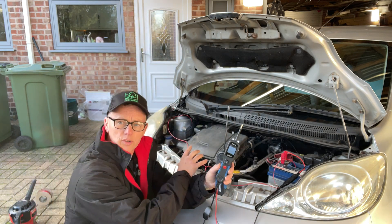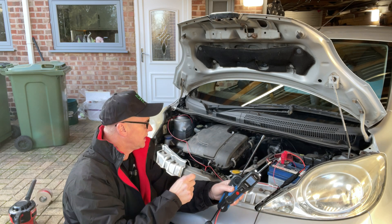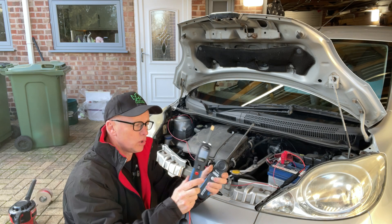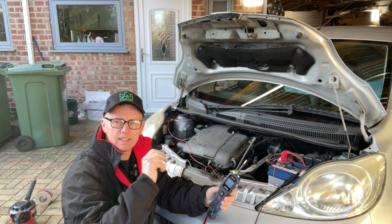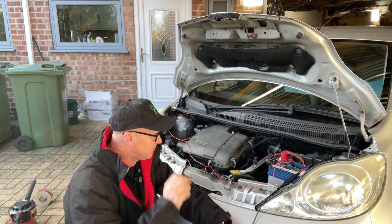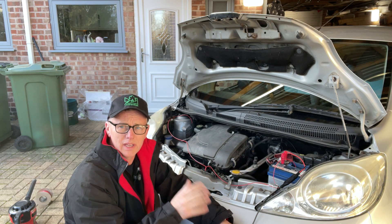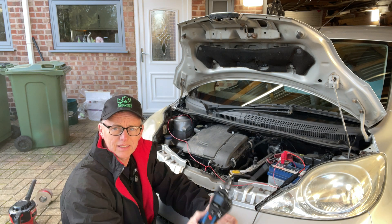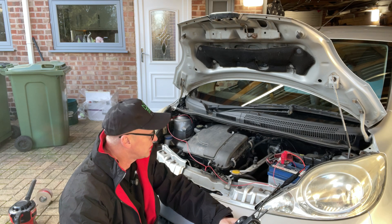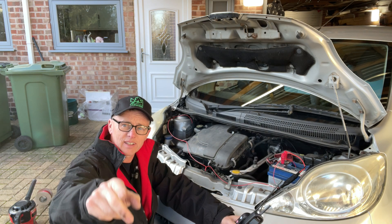So there we have it. We've done some diagnostic testing: I've showed you how to test your coil packs, how to check for injector switching, and we've done battery voltage and fuse checking. It's a really handy tool - power probe, you can power up motors and lights, great for checking continuity. A really good bit of kit. If you're doing automotive electrical testing you do need some sort of multimeter, and this is a good bit of kit to be getting on with. If you've enjoyed this video, drop me a thumbs up, like, subscribe and I'll see you in another video.